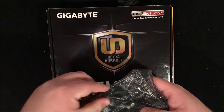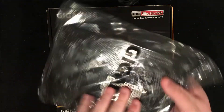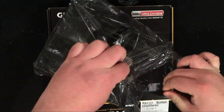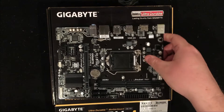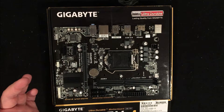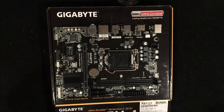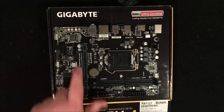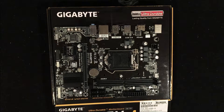As I said, there's really nothing special about this board — picked it up for just a few bucks on Amazon. We have one PCIe 3.0 at 16 times, and then we have two PCIe 2.0. It's important to realize that if you're running a larger graphics card, you may actually cover up one of the PCIe slots, so that may only leave you with just one available slot.